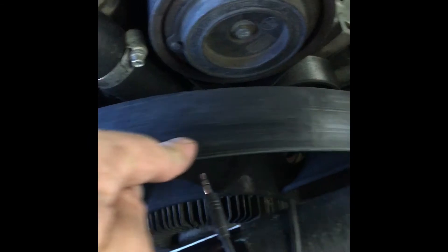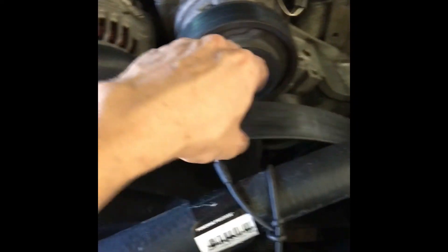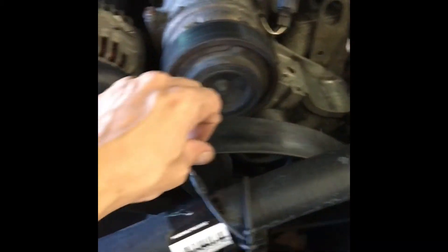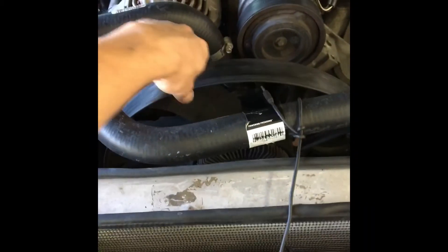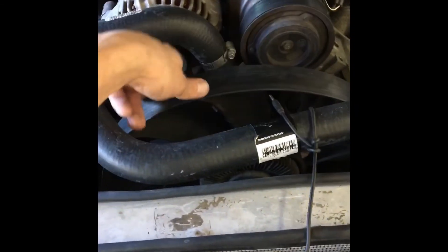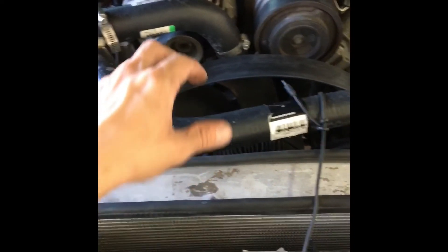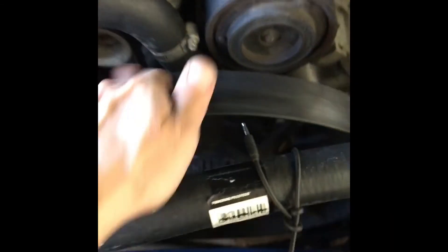It was not the water pump — I could see water coming out, so the pump was pumping fine. Then I figured out my viscous fan is not working properly. When I turn on the car it spins, but it never really engages. I'm able to stop it by hand when the car is fully hot, which means the clutch is done. That affects temperatures at idle, at stop lights and things like that, since there's not enough air being pulled through the radiator.